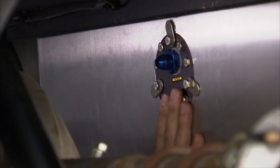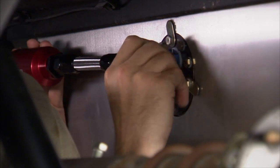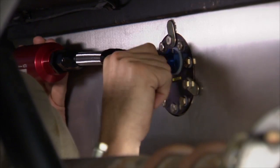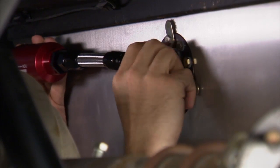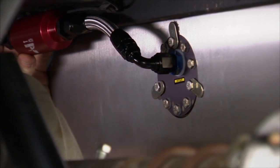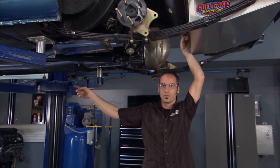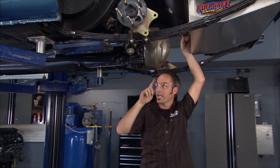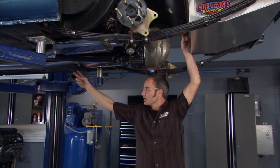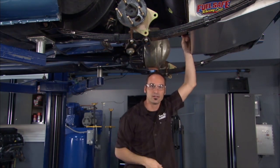Here's the outlet of the pump. I've started making our AN lines so I can start threading this stuff together. Brian's making me a cool little bracket to mount the filter, and that'll tuck right up in place so I can start running my lines. We're going to go on the passenger side because that's where the fuel rail is, instead of the original mechanical pump position on the driver's side up front. So we can skip some routing, clean it up, run our regulator, and return right back to the tank.